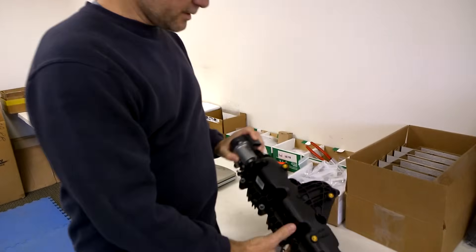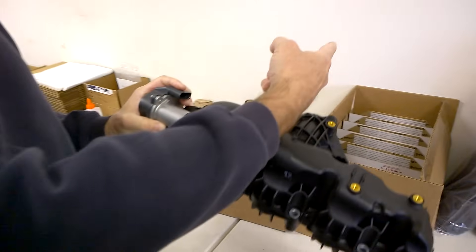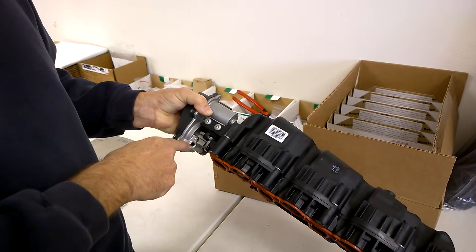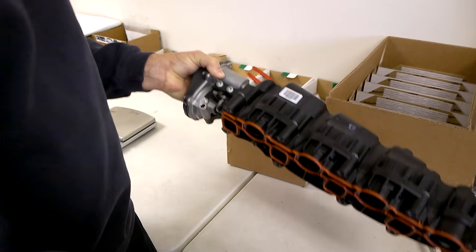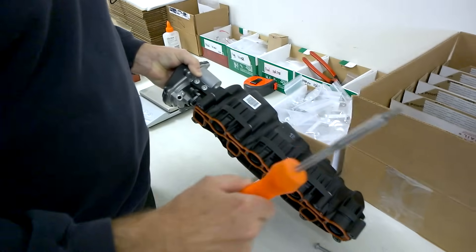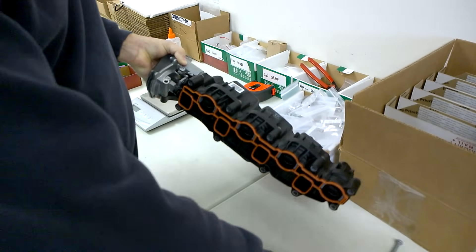So this is the manifold. This is the front of the car. You have three screws to hold the V157 motor on, and you're going to take the lowest screw out — that's right here. You use a T30 Torx driver to remove the screw.